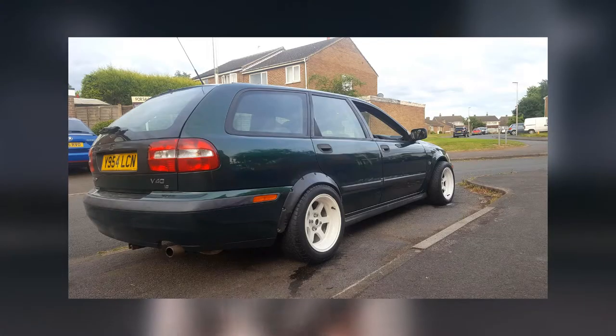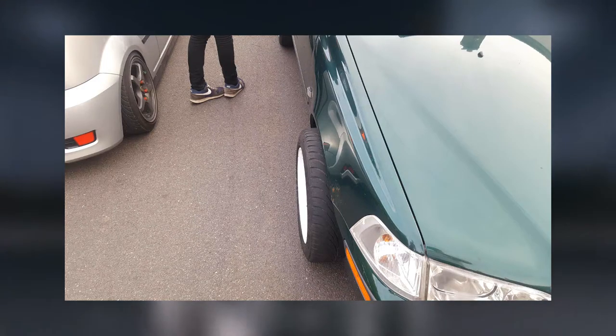So I got some old MX-5 drift wheels. They were in white — I got pictures of that too — but I didn't like the white, didn't really go with the green, so I took them in the garden and sprayed them grey and black. When I put the rotors on they're a lot wider than the BBS were — I think the BBS was 7J, these are actually 8J — and we have 25mm wheel adapters as well. The poke was quite insane; I actually measured it, it was like 75mm. So the front arches definitely needed to go on, because these aren't staggered.